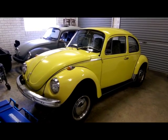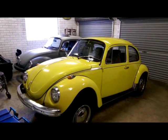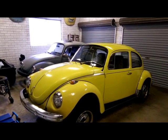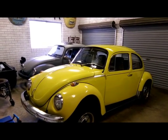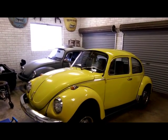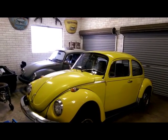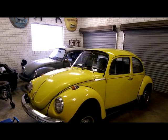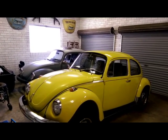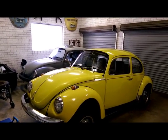So four years ago when I did the alternator install on Tweety, I also did quite a bit of other work to this car at the same time. I put a new clutch in it — which was also a YouTube video I never ended up uploading — I replaced all the shift rod bushing and coupler, put in a quick shift kit, and I replaced basically the entire fuel system because I found, while I had it up in the air, the fuel filter was completely chock-a-block full of rust particles. You could not have jammed one more particle in there — it was full.